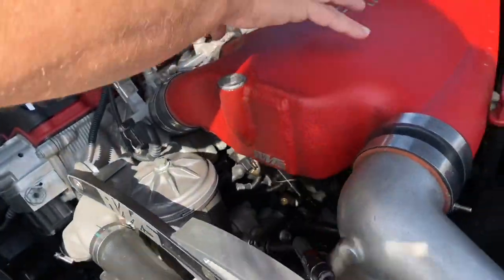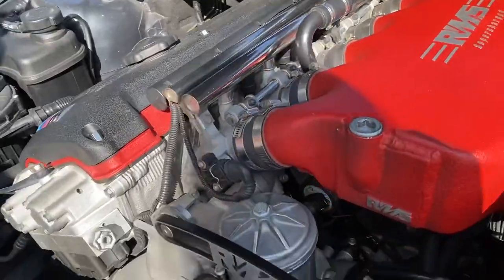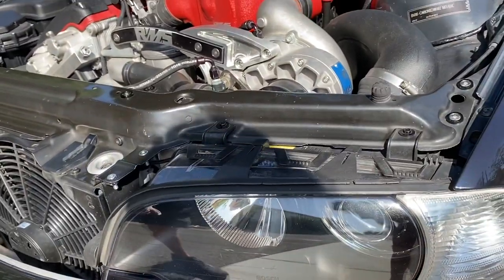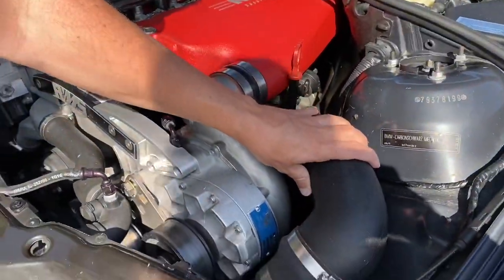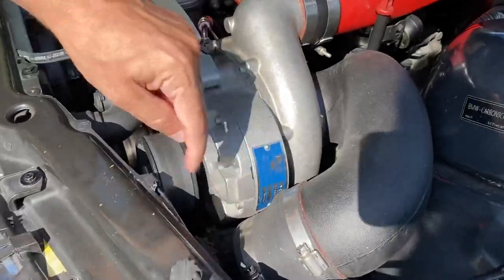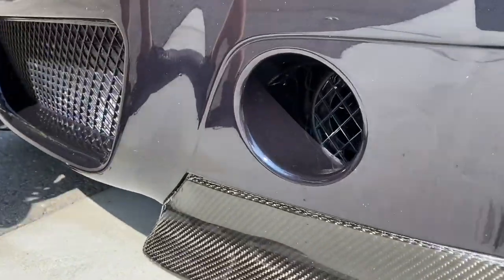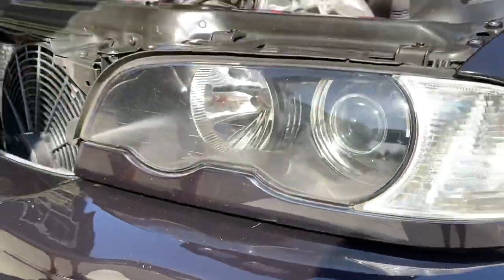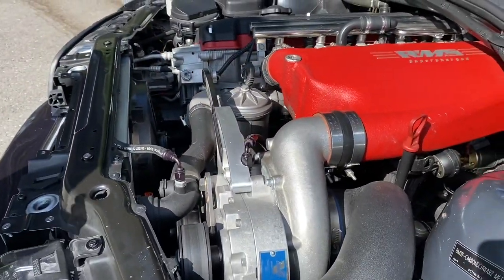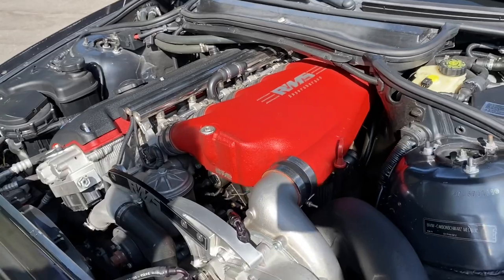It has an air-to-water intercooler — I think it holds five to five and a half quarts. There is a heat exchanger in the front for the intercooler along with a pump. We custom made an intake for the supercharger. The plastic piece is from Vortech, but there's a metal tube that goes down and places the air filter right at the intake on the front end. The tube is mandrel bent — we custom made it and pie-cut it — it's all welded stainless steel with no kinks, completely smooth. That seemed to help quite a bit on the power.